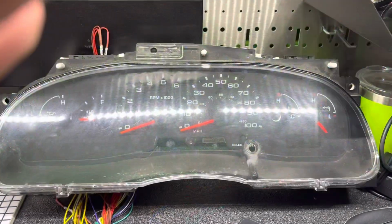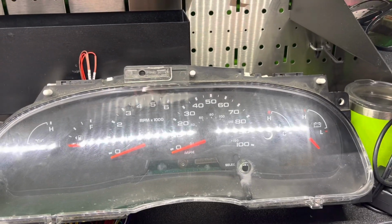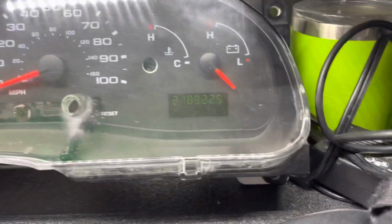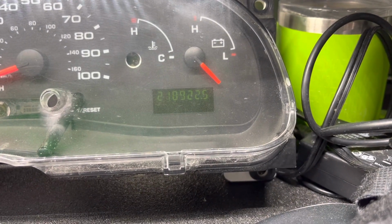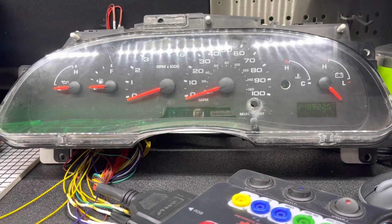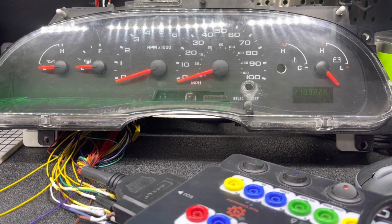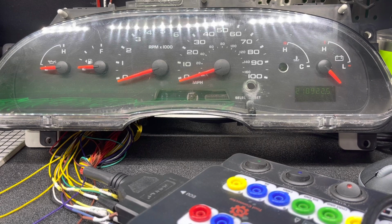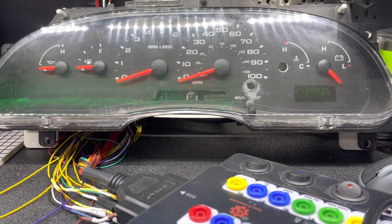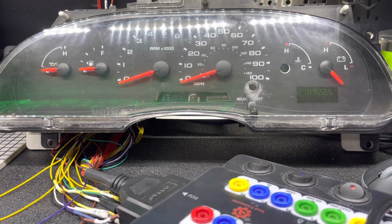Okay guys, so I took off all the solder. I wrote all the information into it. So let's go turn this on and see what the mileage is now. 218,922 miles. So it does transfer the information, as you could see. At this point, we do not have to do a parameter reset. We don't have to do key programming or anything. This will just clone both of the modules, and you could just put it in the car and it will start right up. Everything is basically done.